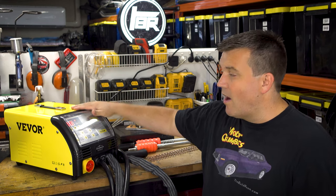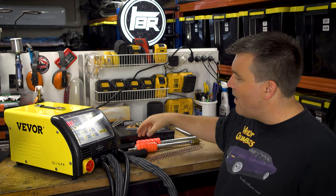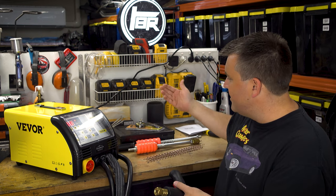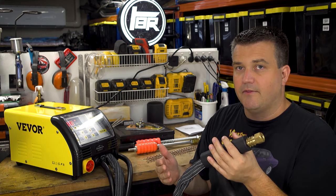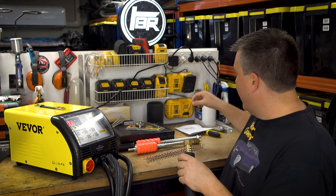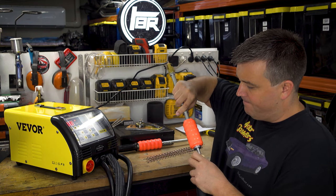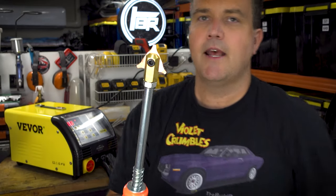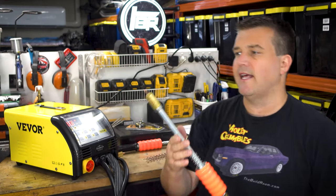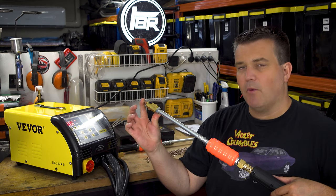So the concept behind a spot welding dent puller is that you have a very similar setup. You have a slide hammer and it attaches to basically a welder for the easier explanation. And you put your slide hammer into your welding gun. And then on the tip of the gun, you have this little thing here, which is a copper electrode with three sides. And what that is going to do is weld itself to the panel. So you can basically spot weld this quickly to the panel.